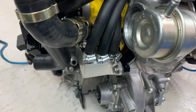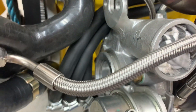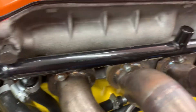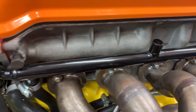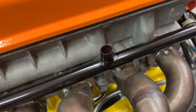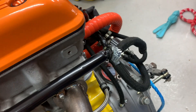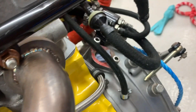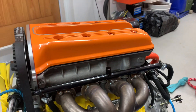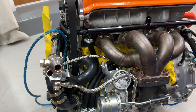Just a quick view with the air intake pipe off so I can show you better. The left hand side goes up and round and returns from the head, and the one on the right hand side goes up the back onto a common rail for the breathers. One goes round to the side of the head and in behind the cam belt — I designed it to go in behind. That one goes up to the collector tank, which I've put in just in case, and then the other one goes over to the breather on the other side. They're all linked together with one common breather point. It seems to work well, it's never been an issue, and it's a nice neat way of doing it.